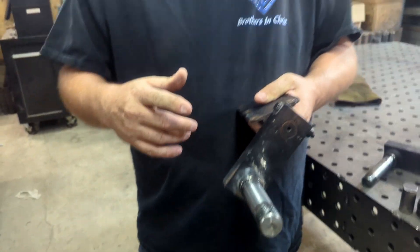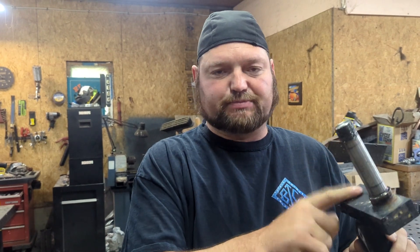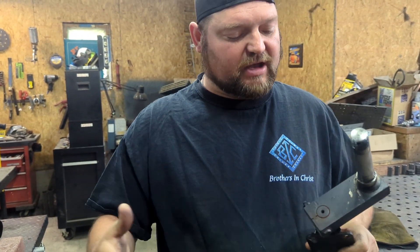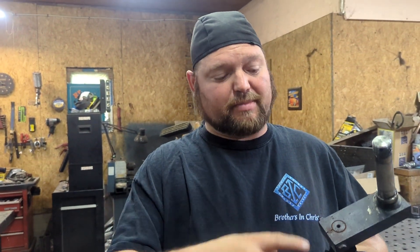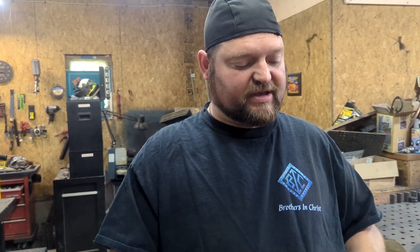So if you have one that's kind of shaking in the back end, and it's not because the bearing is a little loose — you've taken everything apart and you can still grab the wheel and move it — that's this block here. All you have to do is tack the back end with three tacks and then weld it up here. You can do this on the bike. He took the part off and brought it to me, but you can actually just take the tire off, tack it on the bike, weld it here, throw the tire back on. We're going to do both sides so we don't have to worry about it, and then it'll be fixed.